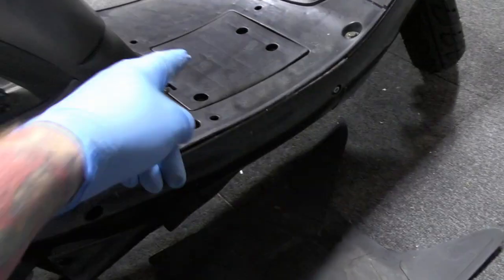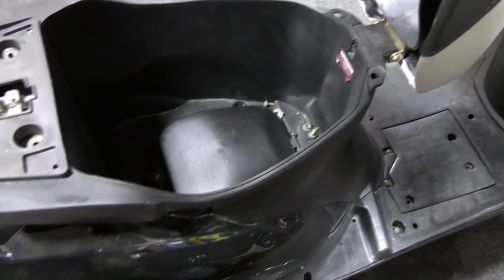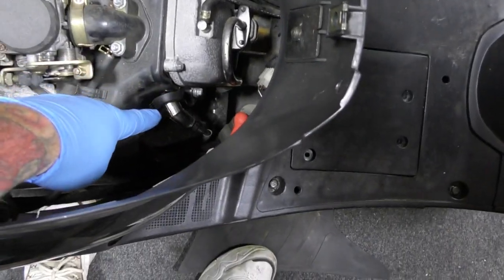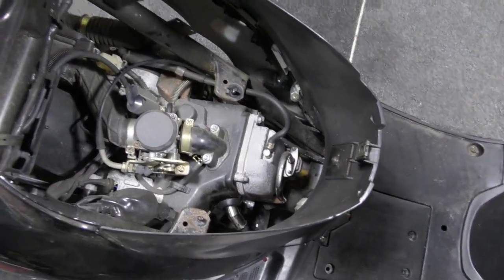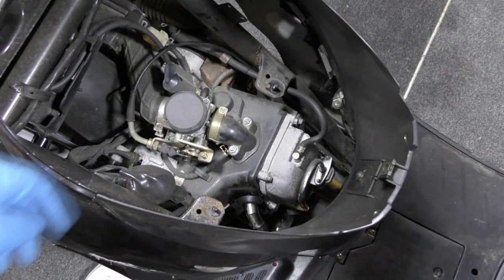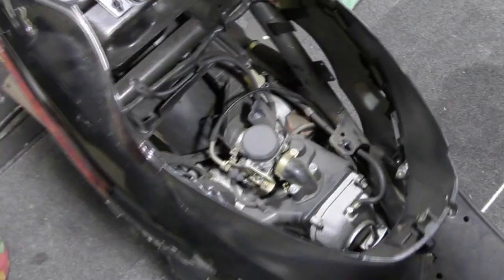Take this up and out — under there's going to be a battery, get that off and charge it. Seat bucket, few little screws, get that out. In here there's a plug, just there. Carburetor, I'm going to take that out, clean it. Plug's already done. Put some fresh fuel in it, drain out whatever we can of the old stuff, and let's see what this little thing does.